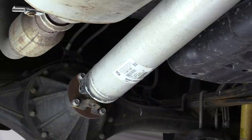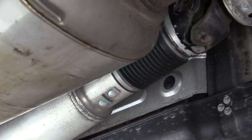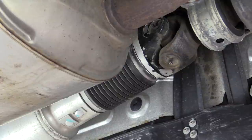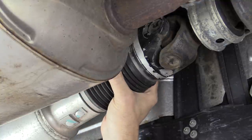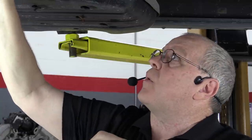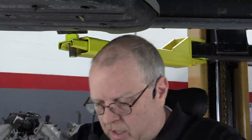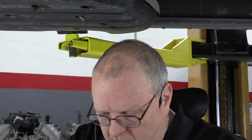On inspections of slip joints, beyond the play measurement, also inspect the boots. If there's a boot tear that allows grease to get out or moisture to get in, that's a problem — the shaft would have to be disassembled, cleaned, inspected for excessive play, and then either replaced entirely if play is excessive, or cleaned up, lubricated with proper lube, and put back together.